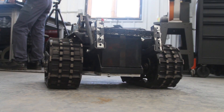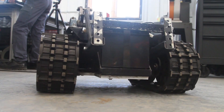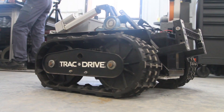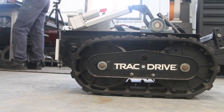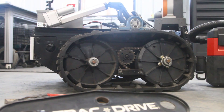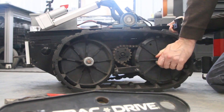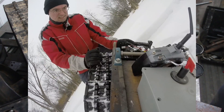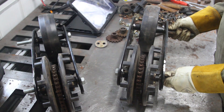I'm not going to just let that go this time. On my other robot I have issues with the alignment of the tracks, issues with the drive chain being too loose, and issues with the drive wheel slipping on the notches on the rubber track.